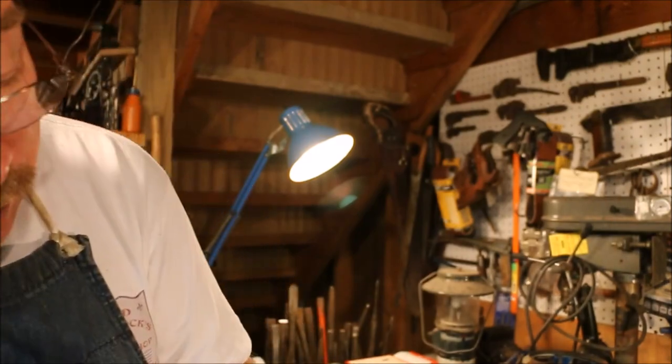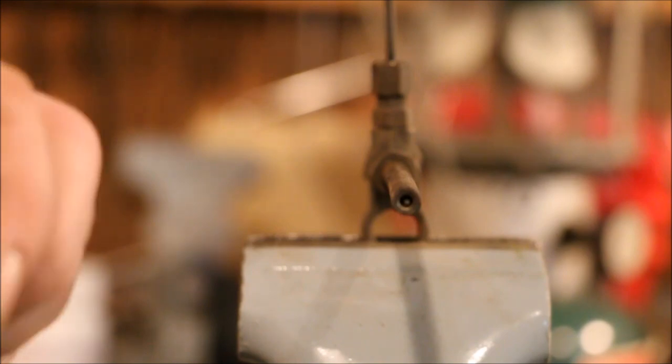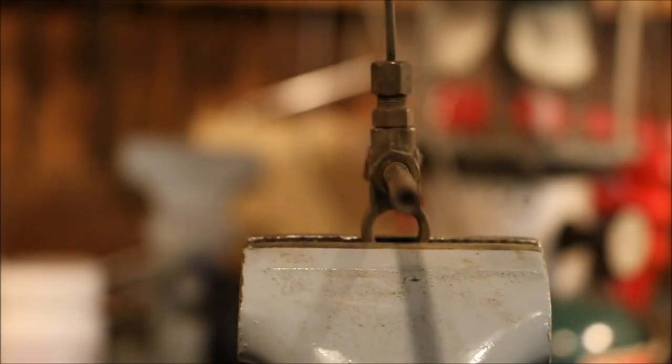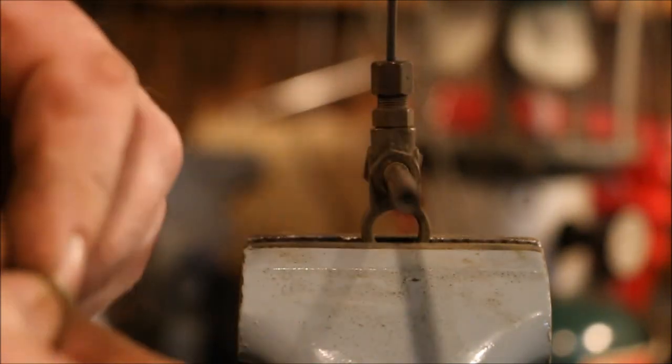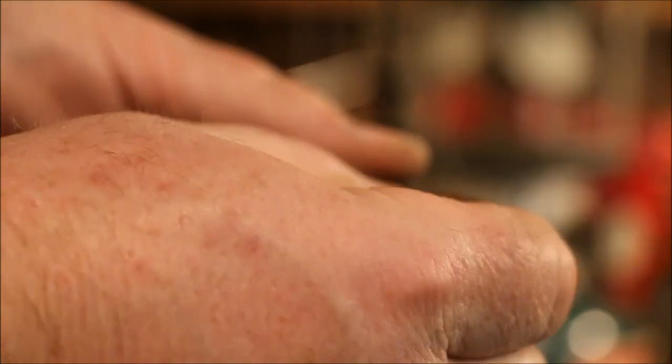Air goes through it okay. Now when I turn that rod, you can see the little plunger moving in and out, I hope. And that goes up inside this little tiny port here and cleans that jet out. Because Coleman knows, every once in a while, despite your best efforts, you screw up. And when you screw up, you get dirt into the tank. When you get dirt into the tank, doesn't work.